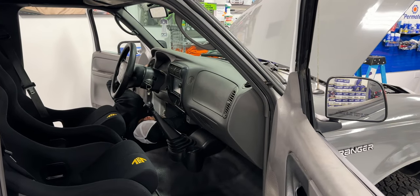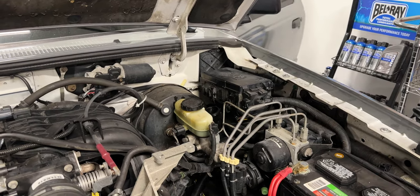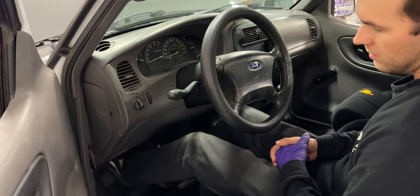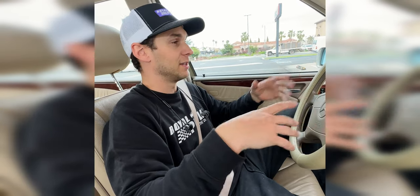We've been jamming on the Orangey, and for whatever reason I can't get the clutch to bleed on that thing. One day I went out there and the clutch went to the floor — can't put it in gear. So it probably needed a clutch master, we put a new clutch master in, and we still can't get it to bleed. We ran a whole bottle of fluid through it and can't get it to bleed. So we're thinking either the clutch exploded somehow or the slave cylinder is bad, so we're going in there to do a full clutch and slave cylinder replacement.